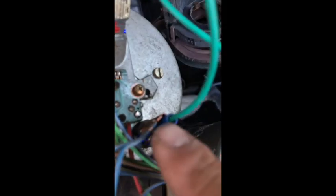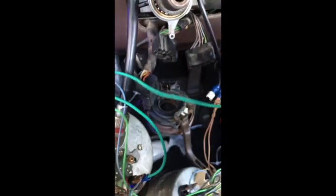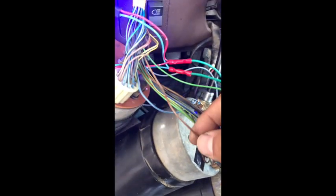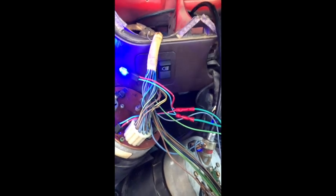I don't know if you can tell here, but I made a little Y connection to one of the power sources, which is the blue and white. And then the ground here, I ran it to the ground that I had gotten from, of course, here, so I'm not overwhelming the existing grounds. As you can tell, they're, gosh, what is this, 18 gauge? Really thin, the original factory. So that's why I did this here, so I could branch out and not really pull from it, even though LEDs don't, that's the case.